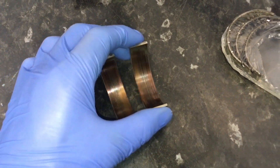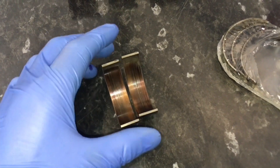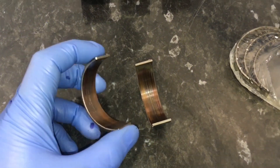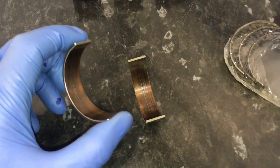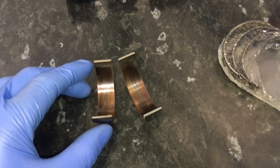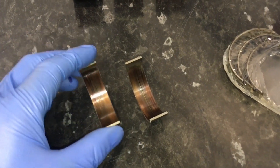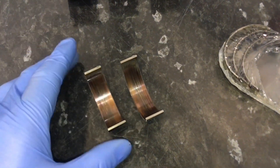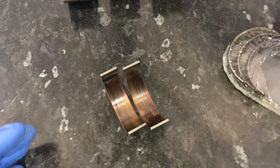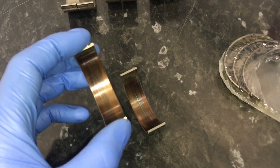For the lower one to be in the same condition as the upper is extremely rare. They've also contracted when you rest them against a normal sized bearing — they've narrowed down — and that's correct because they were both stuck around the crankshaft journal. They weren't in the cap and they weren't on the rod. They hadn't spun; the locating tabs were still present and they were sat evenly distributed between the cap and the rod, but they were tight — so when they took the cap off, the cap came off and the bearing stayed contracted around the crankshaft journal.